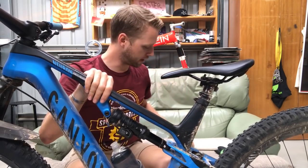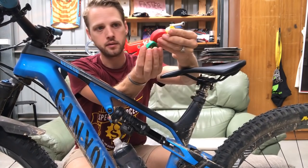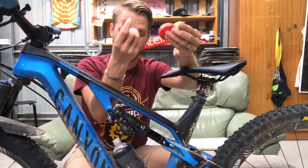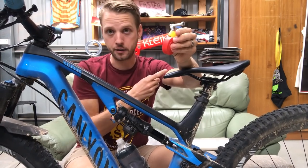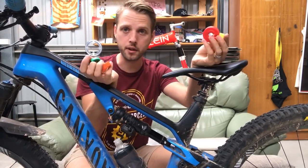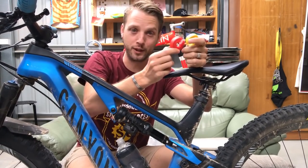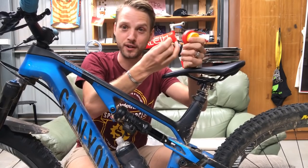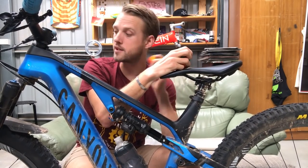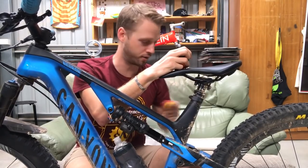But I just wanted to let you know that all these colorful spacers are available for you to purchase, and you can play around with this yourself. If you're fairly confident with letting all the air out of your shock, unthreading the air can and mixing these around, you do have to be careful. Obviously, you don't want to get dirt inside here, and you don't want to put things in the wrong place where they're not meant to be. So you do have to follow the instructions very carefully, but it's a pretty easy thing to do at home. I would say easier than changing volume in a fork, because you don't really need any special tools to do it on the rear shock.